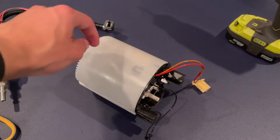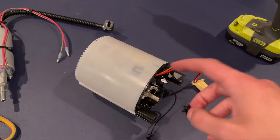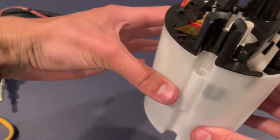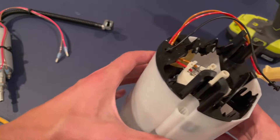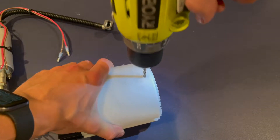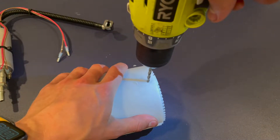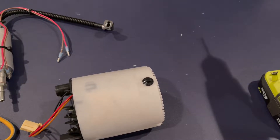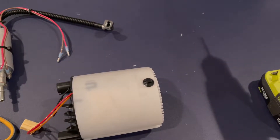Where the wires come out, you can drill a hole for the pump retention clip, so you can zip tie the pump onto the bucket so it's not just floating around in your gas tank. One thing to watch out for is the fuel filter inside — it's kind of like a large tea bag. When you're drilling, make sure you don't accidentally cut into that, so go really, really slow and verify you're not going to hit it. I used an 11/64-inch bit and it worked really well.